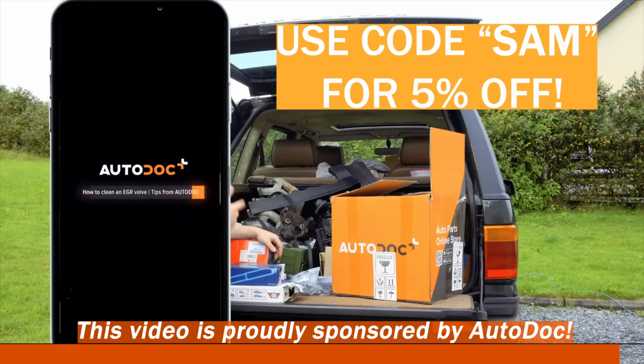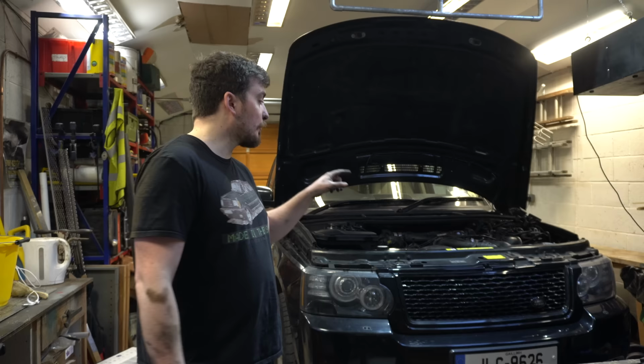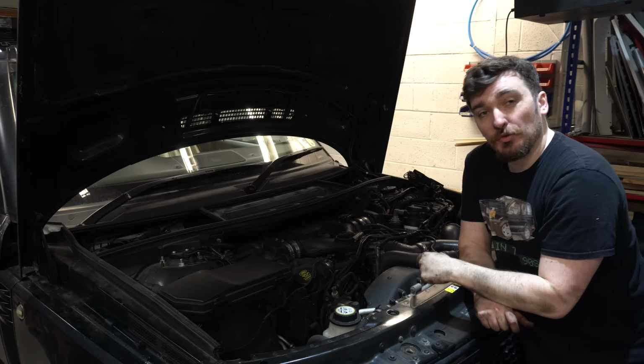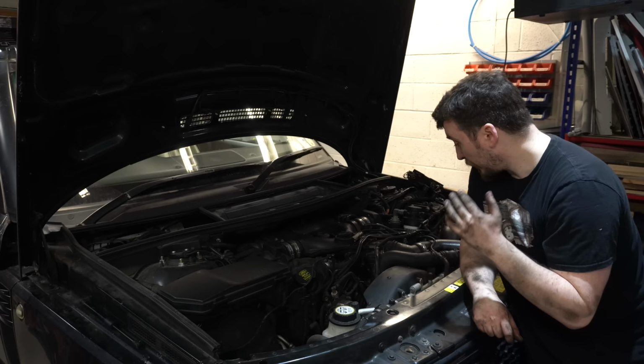So now that's out, I'm going to head back underneath again and start taking out as many of the radiator shroud, fan shroud fixings as I can from underneath, and then we'll come back up the top again and do the same on the top. So I think that's all the screws that I can get to from underneath. I'm done. I'm actually surprised I put as many back in as I did, because it's a real pain in the ass to get to some of those, even with the valve and everything taken out. But anyway, now we can start working on the top half.